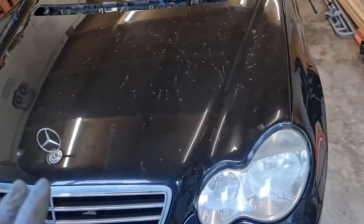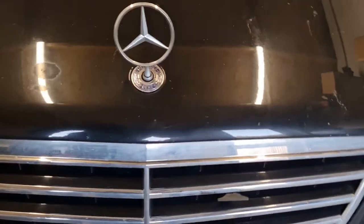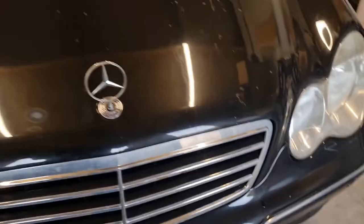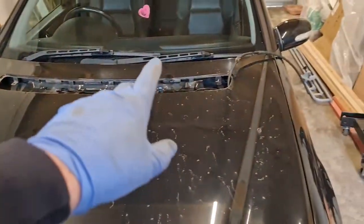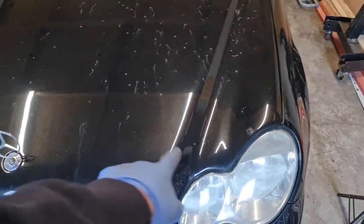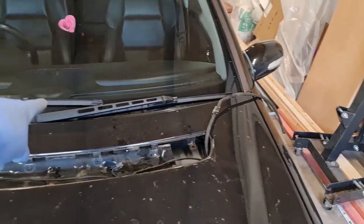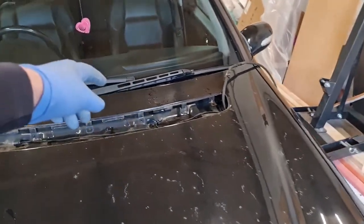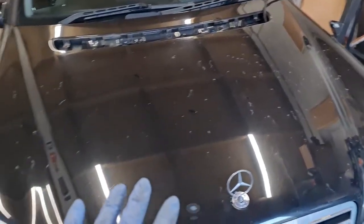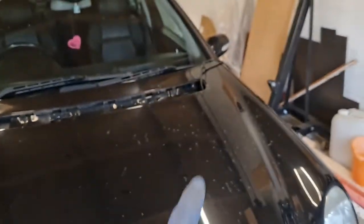Just a little top tip for you. As you can see, the bonnet is open. As you can see the little tail for the hook there, you have to close that right down. Otherwise, the wipers won't work and the jets won't work. It's something to do with the way that it clips in. It's a safety thing, because if the bonnet is open, it stops the wipers from possibly hitting the back edge of the bonnet. So you've got to shut the bonnet before your wipers and your washers work. So right, let's crack on, let's give that a go.